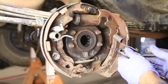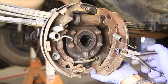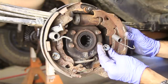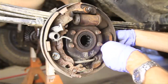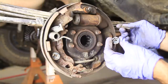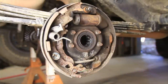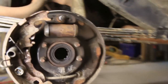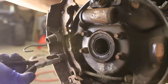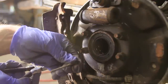This is where that special tool comes in a little bit handier than just a pair of pliers — it's able to grab it and rotate it a little better. I just pushed that spring in, rotate it, and there's like a keyway in there. Once that keyway fits through the pin, it locks in like this and then it comes out like that. So that'll go back in the same spot. For the left side, all I did was push in on that spring and then rotated the back until it fit through that keyhole.